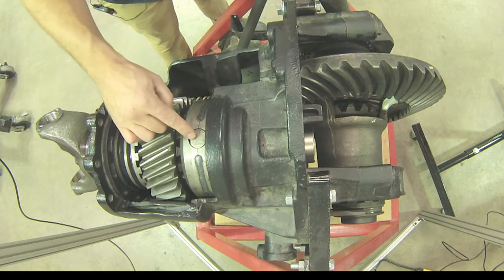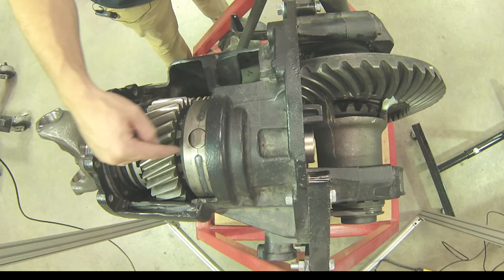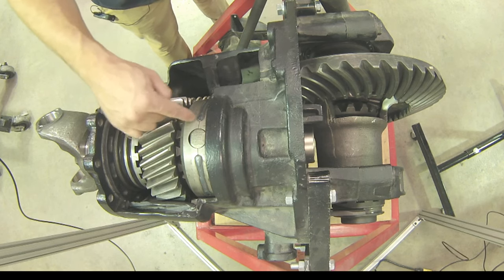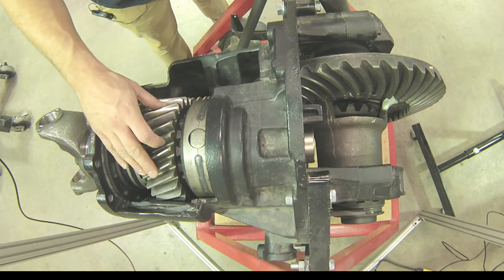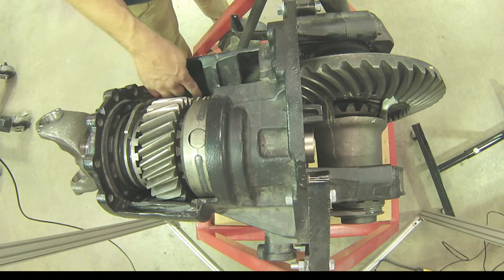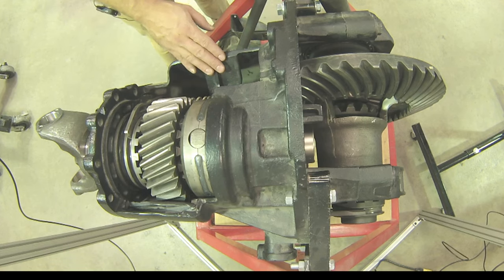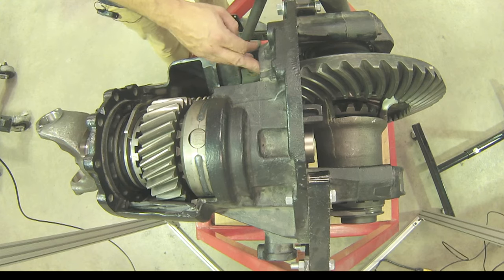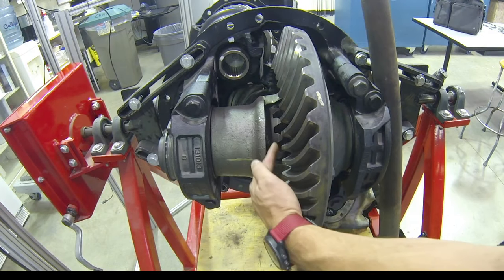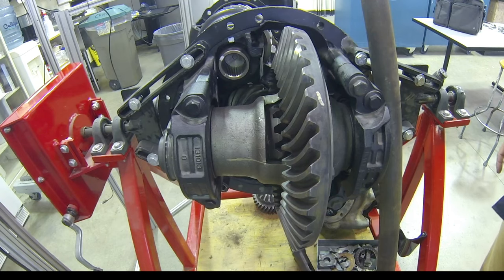If we turn this to the top, we'll see a small circle — that's the differential cross shaft. So we go from our input yoke through the input shaft to the differential cross shaft, remembering that the inside of that cross shaft is splined. Then we drive through the differential pinion gears to the side gear profile, remembering that the side gear profile is actually cut into the helical drive gear. From the helical drive gear it goes down to the helical driven gear, which is the same piece as our pinion shaft — splined to our pinion shaft — and we drive from the pinion to the bevel gear and then from the bevel gear into our differential case. We can see the cutaway of the differential case and the side gear going to the axle shaft from inside the case — that's our path of power.